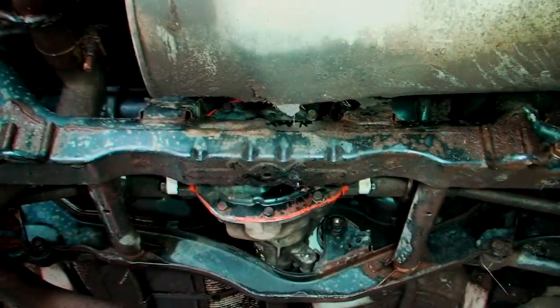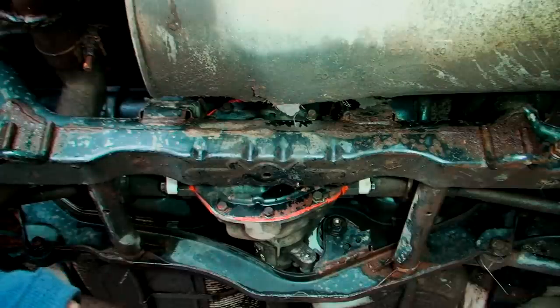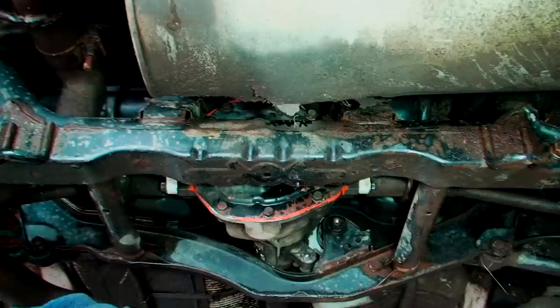Then I'm going to tighten with the air gun. I've tightened the six bolts that are bolted to the diff — I haven't tightened the main bolt that goes through the bushing because that can't really move. The diff is still loose, only nipped. Now I'm going to spin the wheel again. There's no real play in the bushings where they go in — the hole is more or less the same size as the bolt — but I like to do it just to make sure it's right. So now I can give all these a good final squeeze.